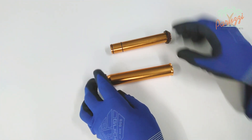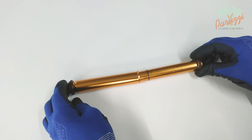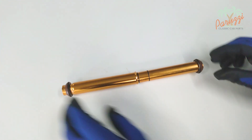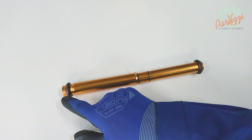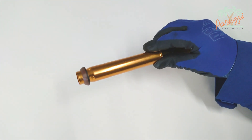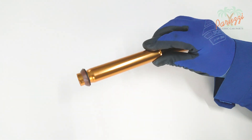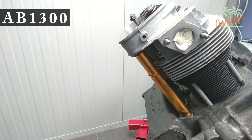The spring fits into the longest tube, and the shortest tube slides into the longest tube. This version has an end that goes deeper into the crankcase, also called windage. This allows the engine oil to stay in the crankcase better during sharp turns. So you have to install these spring-adjustable pushrod tubes in the right direction — the side with the longest part beyond the rubber seal should be on the crankcase side.